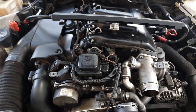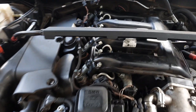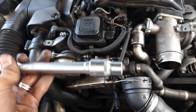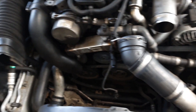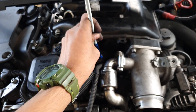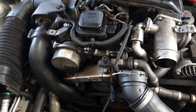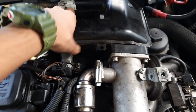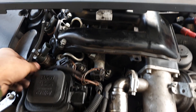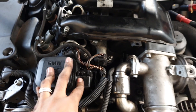From where we last left off, I removed all the intake bolts except for the 11mm ones, which are down here — one, two, three, four, five on the intake itself. You need an 11mm socket and a magnetic bolt grabber so you don't drop those nuts, which is quite annoying. From there, just remove the intake to get access to the injectors — one, two, three, four — and the return hose, which I'll remove in a few moments.